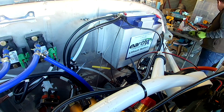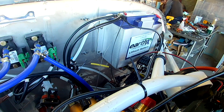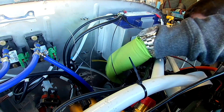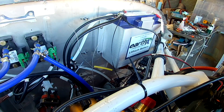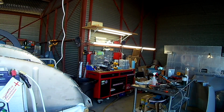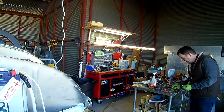One of the most important things on your firewall: sealing up the pass-throughs. I bought some Strata-flex line — these are three-quarter inch, so I bought one-inch and you trim it to size. Each pass-through gets two pieces of Strata-flex: one on the inside surrounding all the wires and another on the outside. On top of that is a stainless steel pipe clamp, the whole thing surrounded by silicone tape, and on the inside among the wires it's jammed full of 3M fire barrier. You also saw me with pro-seal, which means in the next video we're putting on the top skin. Thanks for joining me — see you soon!